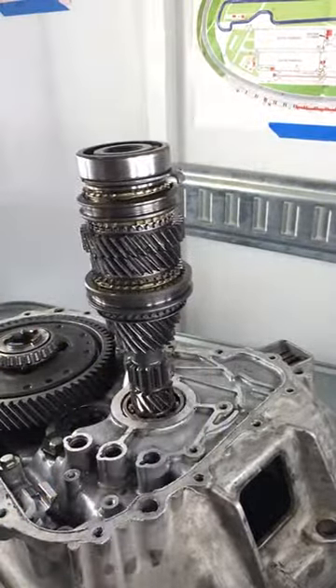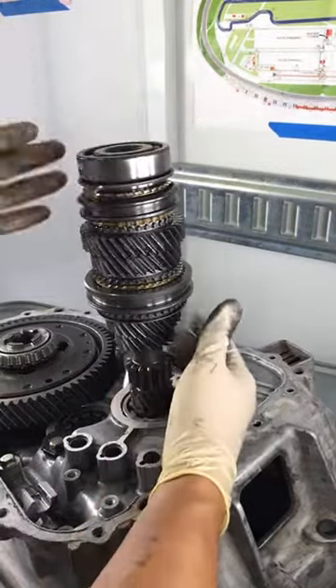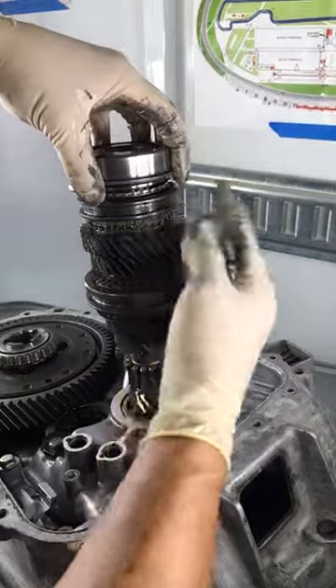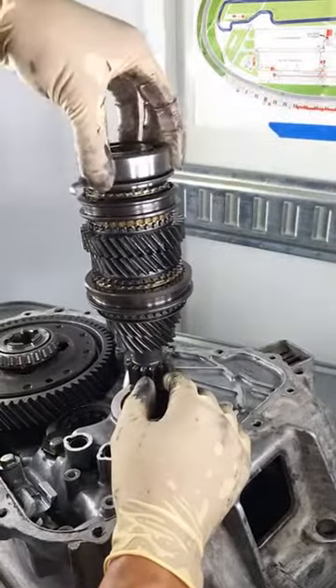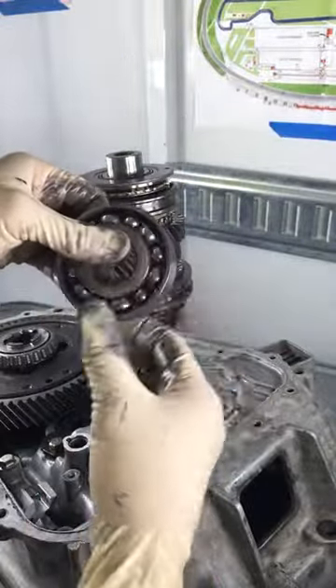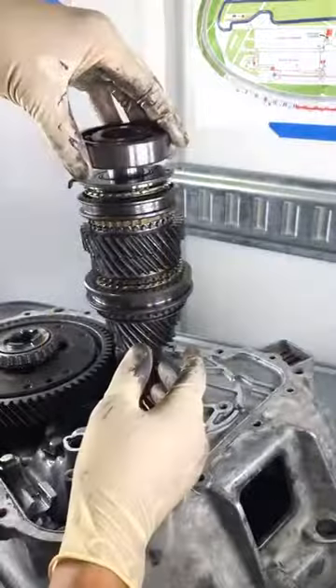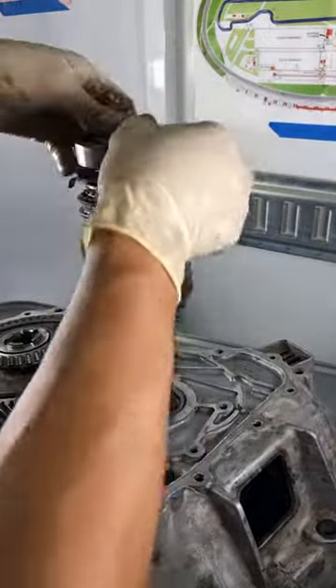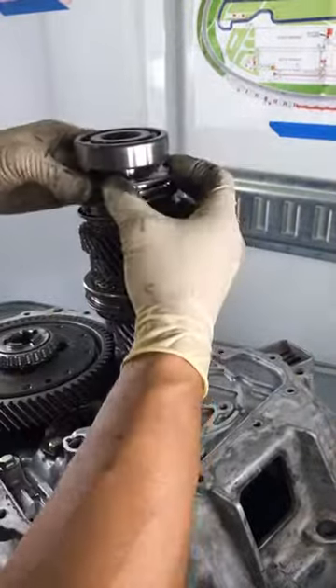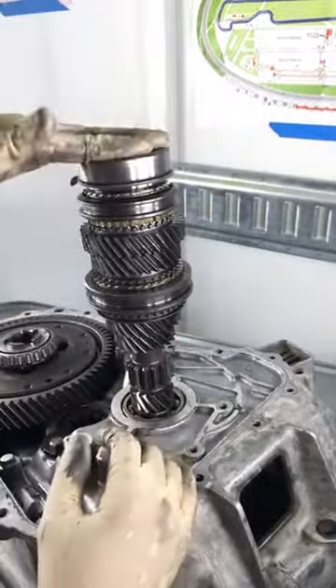And that's pretty much the basics of a transmission. My sleeve is damaged, so I'm going to take all this apart, review all of these bearings, and make sure everything is good. I'll probably end up replacing all these bearings because it's just cheap insurance — you don't want to go through all of this and then have a bad bearing and have to go in here again. All you had to do was just switch out these bearings. There are really only four bearings in here.